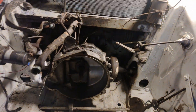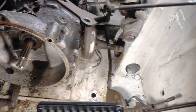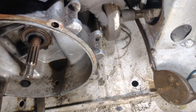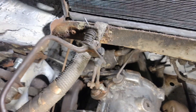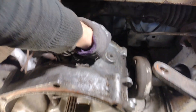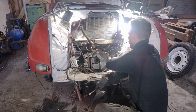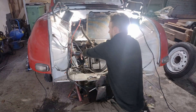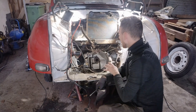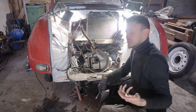The next part of this task - let me get some light in the engine compartment - is to unbolt these things right here, and also to start disassembling this plate in here. It's a little difficult to see. The same on the other side, and there is actually a bolt in the cabin that holds this entire setup in place. I've now loosened all the bolts on either side together with this plate, and I just need to disconnect these two here and take the transmission box out.